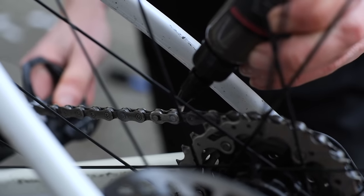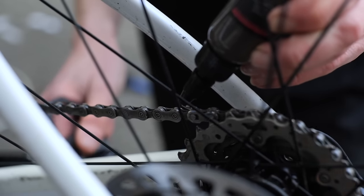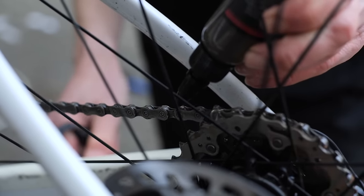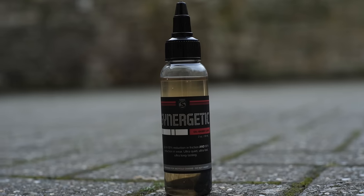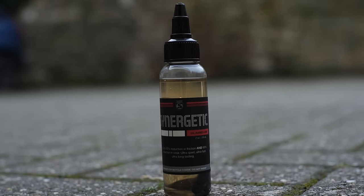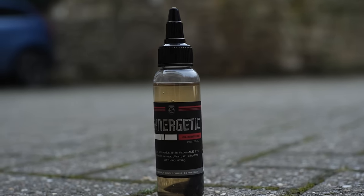Wax-based lubricants set to pretty much even just a semi-solid or paste, which still has a higher dust contamination resistance than a wet lubricant. Wet lubricants by their nature are sticky to dust, and being wet they have a pathway to transport themselves from outside the chain to inside. Wet lubricants can be really convenient — easy to apply without set times — so for some cyclists a good wet lubricant can still be the best option. It's definitely better than no care at all. A top wet lubricant, especially for road cycling where dust isn't a major issue, can be a great option.